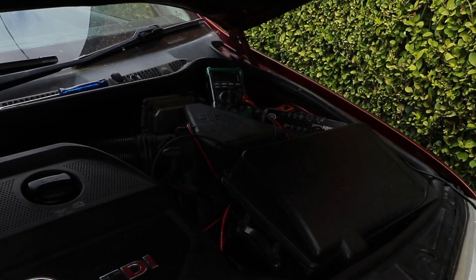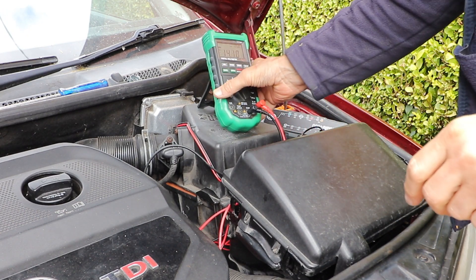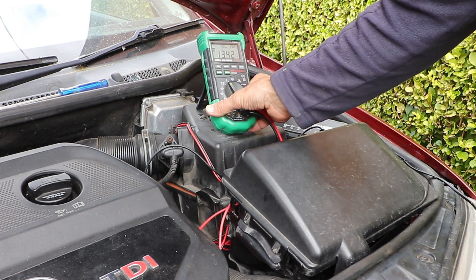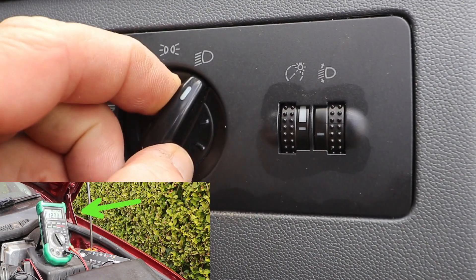So I've let the battery charge overnight and put the voltage meter on. It's reading about 14 volts but the charger is still on — I'll just turn that off. Now the voltage will drop down. I'll leave it for 10 minutes and see where it settles. It seems to be settling at 12.87 volts after about 10 minutes, which is probably still holding some residual voltage from charging. I'd expect that to drop a little bit further. What I'll do now is a simple test by loading some electrical equipment — such as turning the lights on.